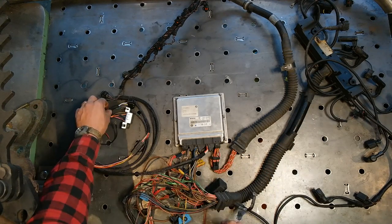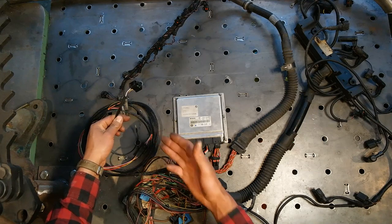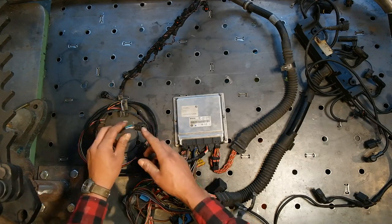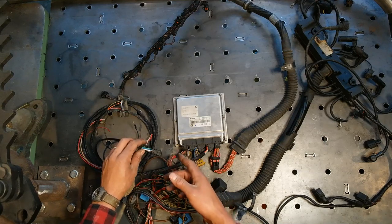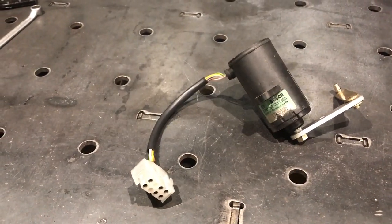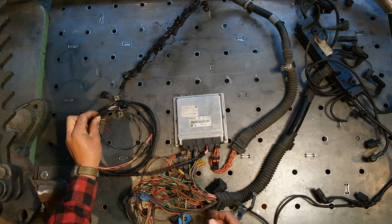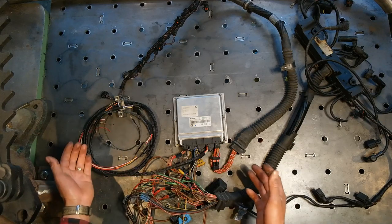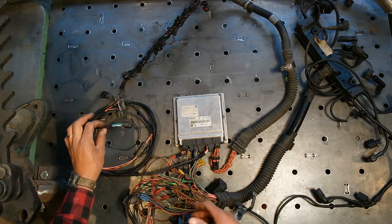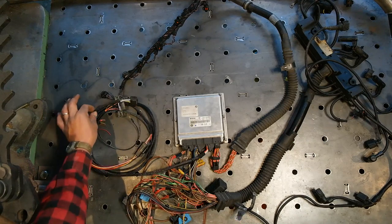After this there's really not a lot to get this started. All you need is to ground this to a ground point and install your accelerator pedal or potentiometer. This potentiometer is for the newer M57 — the older 530d has a cylindrical type potentiometer, while the newer ones have the potentiometer built into the accelerator pedal. This plug is for the newer type. If you're looking for a pedal, try to find one with the potentiometer built in — it's a tidy little unit. I ended up getting the accelerator pedal and installed it and kept it simple. That plug plugs directly into the accelerator pedal.